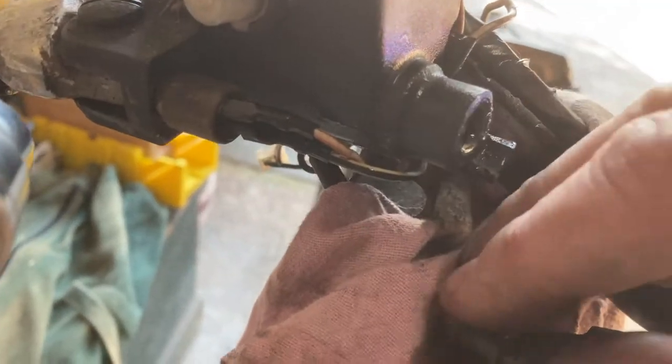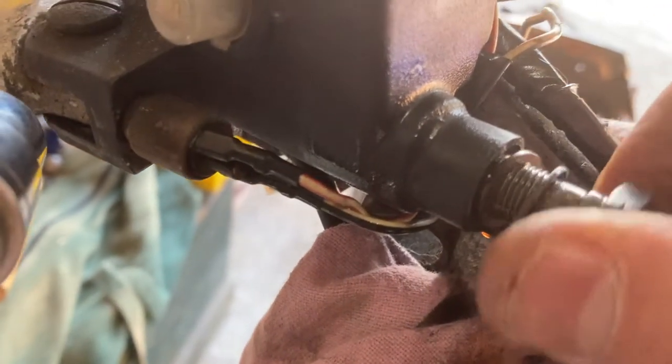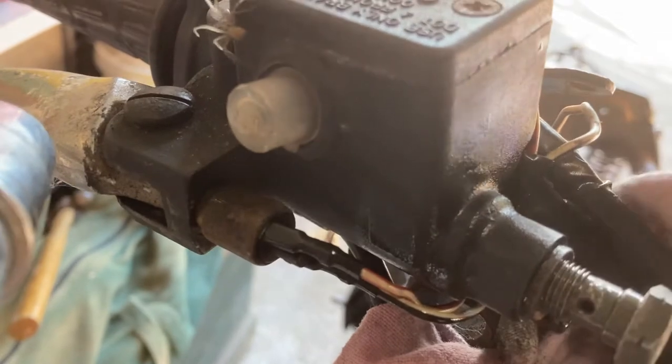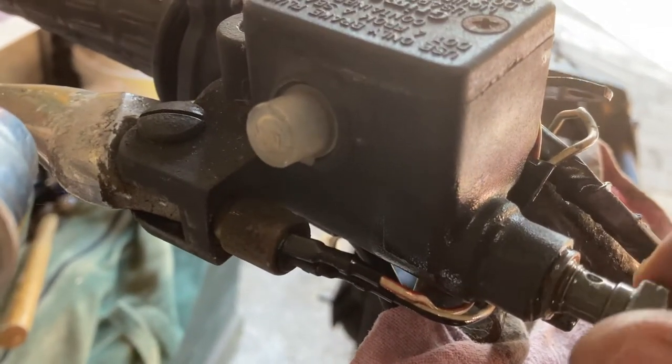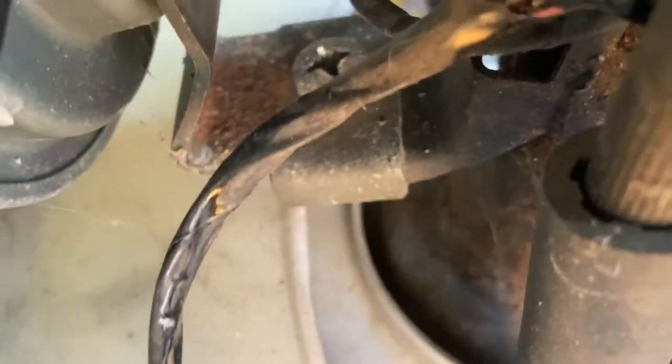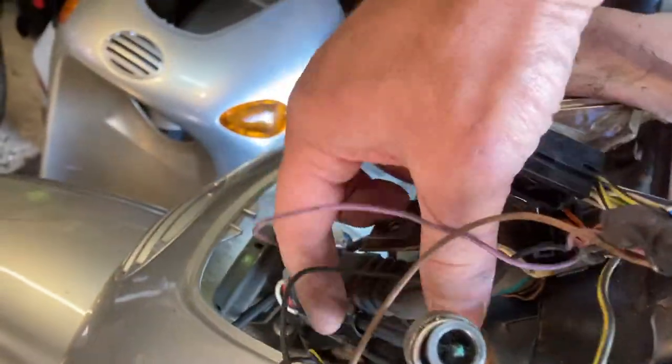Keep all your parts — make sure you don't lose any of these bits. I like to just pop them back into the hole they came out of — just stick it back in ready for the next one. That then frees up this pipe here which you need to free up because it goes down through the bodywork. The speedo cable comes up here and connects into the instrument panel originally — it should be able to just be pushed down and through that hole.